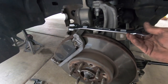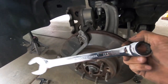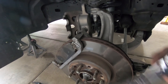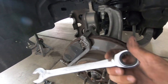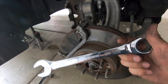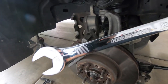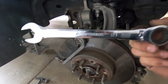Just a quick tool tip: do yourself a huge favor - if you plan on doing a lot of work on your Ram truck, get yourself a 21-millimeter ratcheting wrench. I swear, this size is used on almost everything. When I was doing the control arms, suspension, any sort of lift kit, 21-millimeter seems to be the go-to size for a lot of the nuts and bolts on these trucks. Spend the money - I think this is about 25 bucks from Menards, it's Masterforce. Once you break everything loose with the breaker bar on those 21-millimeters, it's a lot easier to go ahead and use a ratcheting wrench. If there's one tool you buy to support a truck project, a ratcheting wrench in 21-millimeter size is the one to go with.